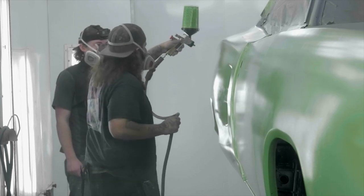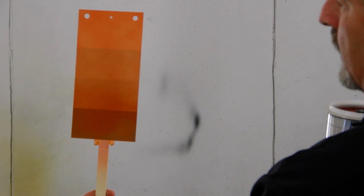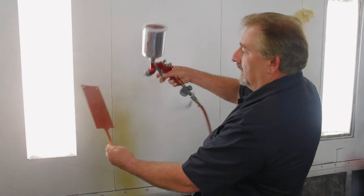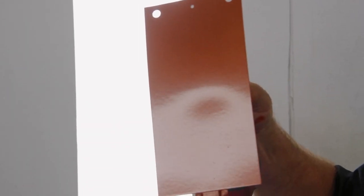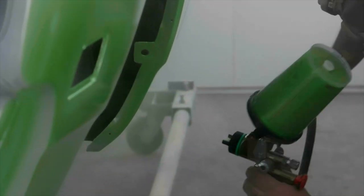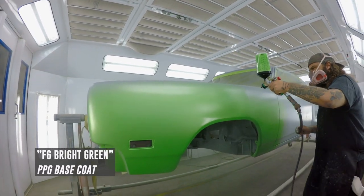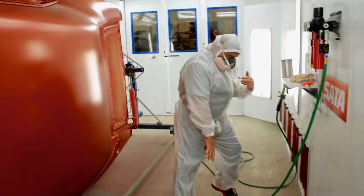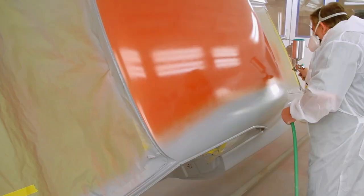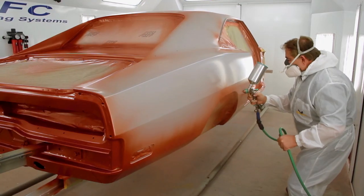It was a very challenging car — a very transparent color. It's not like you go in and put one or two coats on; it's a base coat, clear coat, and you're looking at seven or eight coats to cover. I always hated transparent colors because you're in there hour after hour putting paint on, trying to get it to cover. Get a couple coats on, wait half an hour, let it dry, tack it off, a couple more coats — it's just very methodical. Going back to our FK5 burnt orange car that I promised the owner I would paint myself — I did — it was 11 coats to cover that car.